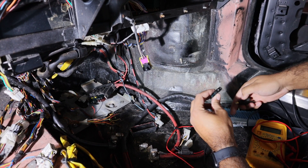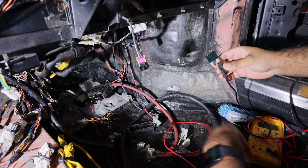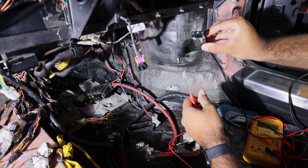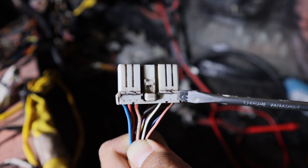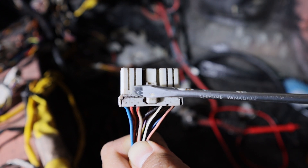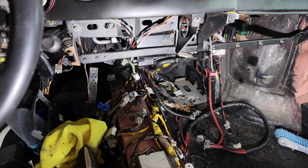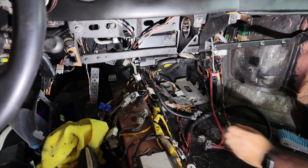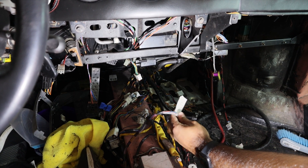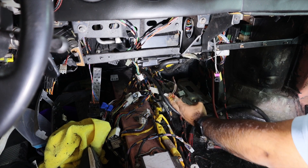We've just taken that fuse box off — there are a few fuses in it, and what we can do with the multimeter is check that these fuses still work. Connect the common onto one end and check the other — if it beeps, that means the fuse hasn't blown. These actually have number labels on them: one, two, three, four, five, six. In between filming we've been starting to get on with some of the work, taking connectors, looking them up in the workshop manual, and starting to label them.